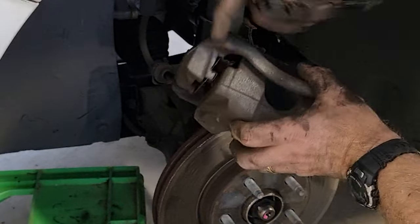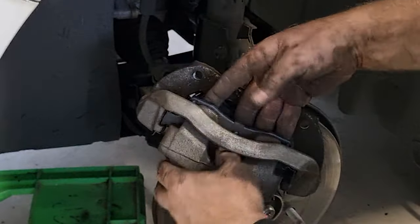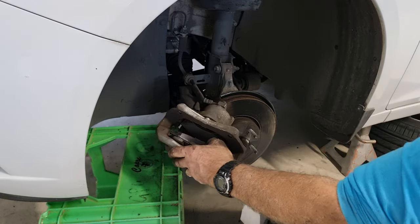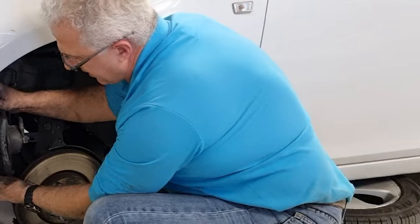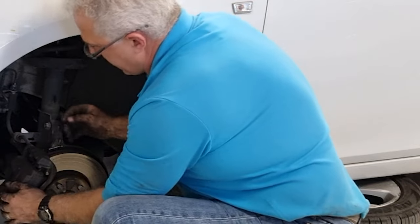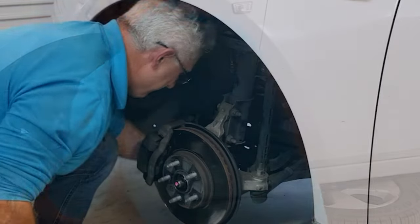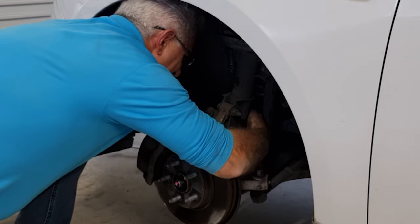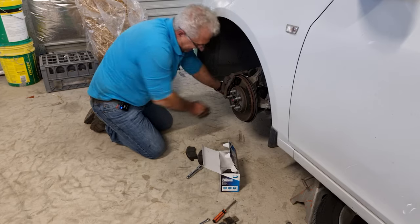This is the opposite end — just got to go through this little bracket here, go through the side, and put it in the opposite end as well. So that's now sitting in nice and tight and it's not moving. All you've got to do now is put the caliper back — turn it around and put it back over the disc. It should fit comfortably because we pushed the pistons all the way back, and then you just put those two screws back again. Okay, that's the first one in. That one's done.